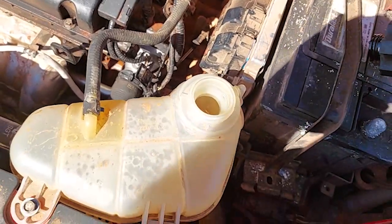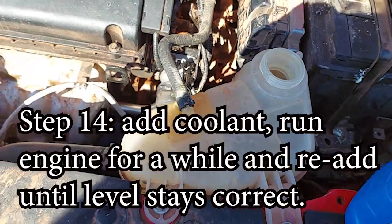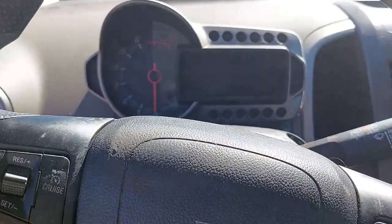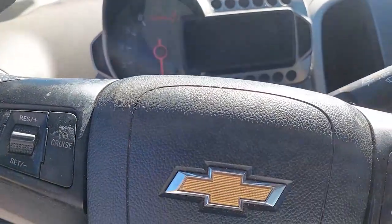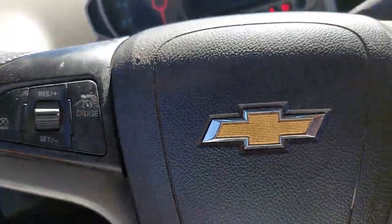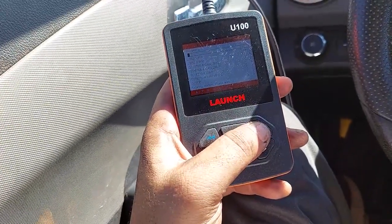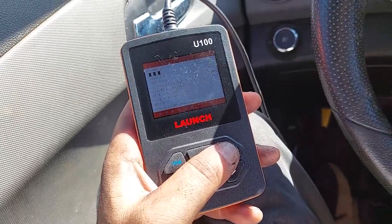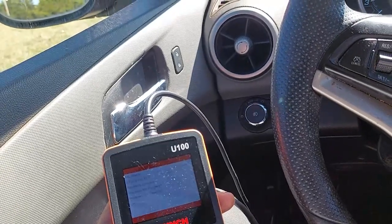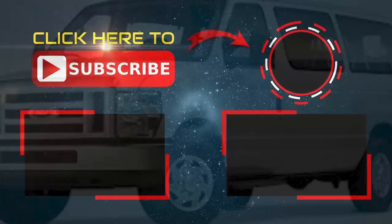Just add some coolant, start the car, run it a while, and fill it up to the fill line until everything is good — and that's a wrap. I replaced the thermostat, went for a test drive, the fan is not cutting on like it used to, and no error codes — everything's clear. So that's how you can change your thermostat if you get one of these error codes. It's not the easiest job; you definitely want an extension and you need a 10 millimeter and 8 millimeter socket, but it worked.